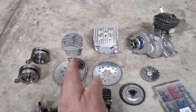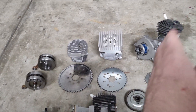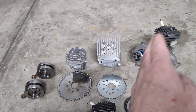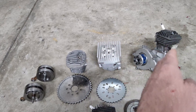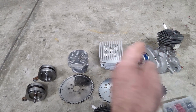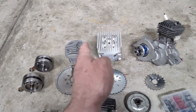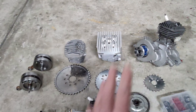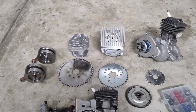That's the difference. If you change the roof angles and the port heights and all that, you can kind of get one of these in. The squish value is a hell of a lot different between these two. One's designed for more power, one's designed for more speed. There's a lot to that.